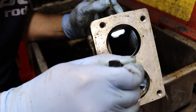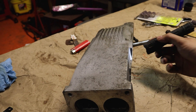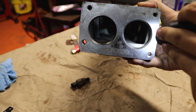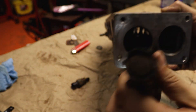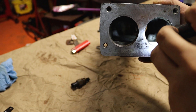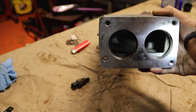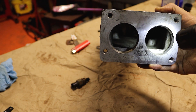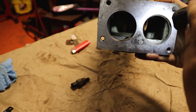When it comes to porting the TPI, there are a few key things to look at. If you look at the front where the throttle body goes, you'll notice this ridge — it essentially blocks off holes that go back to this area. We're going to start by knocking down this ridge to make it flush with the floor. That's the most problematic thing to begin with, especially if you want to go with a bigger throttle body. Let's get started with the die grinder.